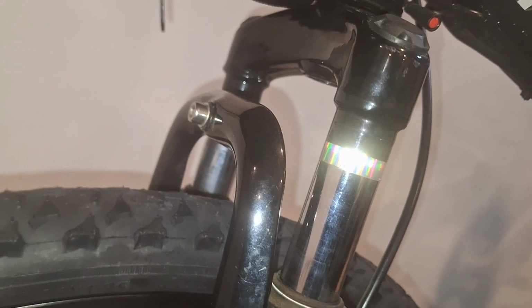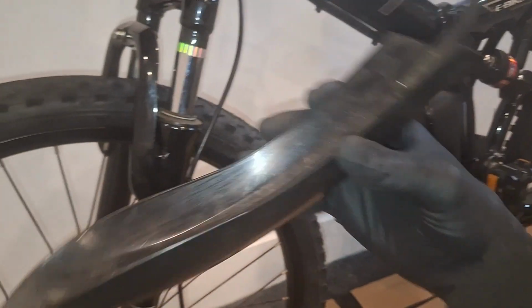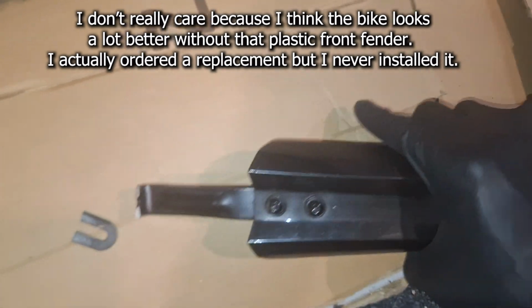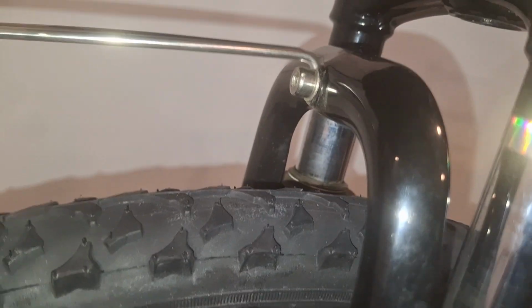One thing I did have, and that's just because of vibration. This part, the fender, it just completely broke off one day because of vibration, because it's so long and it's moving around and flexing, and the part that goes in front here, it's split. And it broke from the rest of it because of vibration and metal fatigue. It's the same thing with this headlight, where it attaches there. This part where it attaches to this part. Of course, metal fatigue and everything else, vibration, it ended up breaking. But, I don't need this light anyway because I have my own.